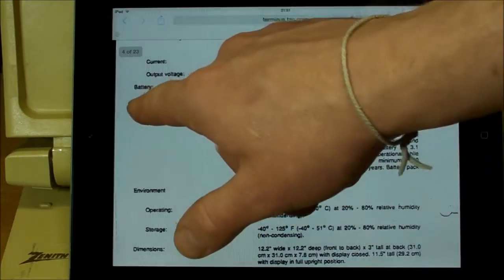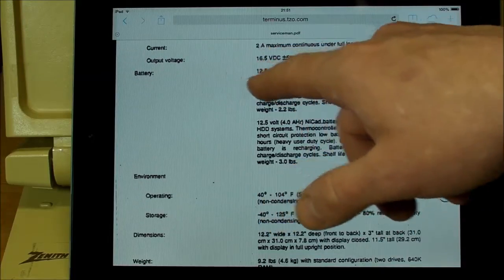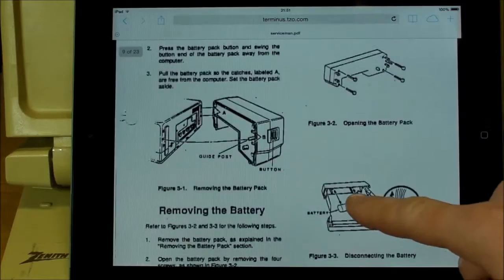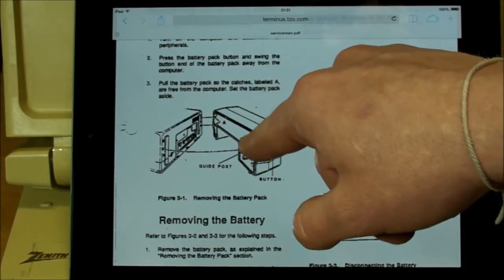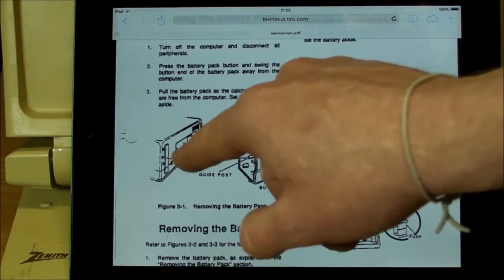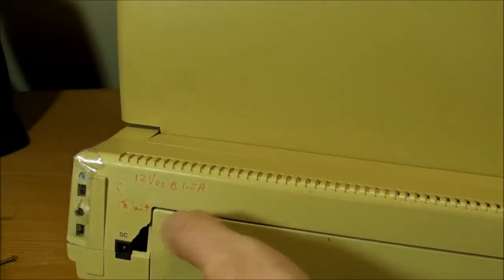Here's another thing — battery. I noticed it early on, and there was no battery inside this beast, which surprised me. But apparently it does have capacity for a battery: a 12.5 volt NiCAD battery pack, removable. That's a picture of the back of the computer, and the battery pack attaches with hooks through some holes on the back. This whole thing is the battery pack, with a slot underneath for all the port connections.